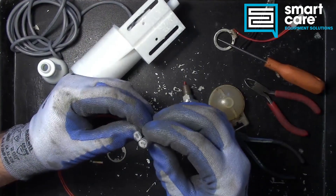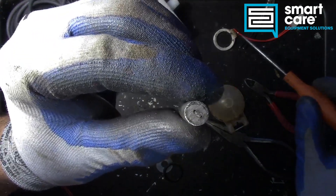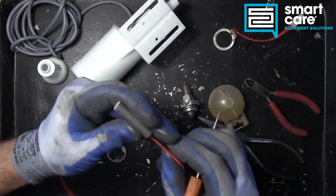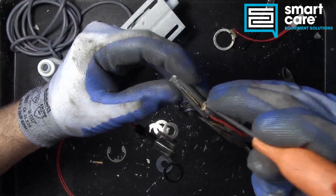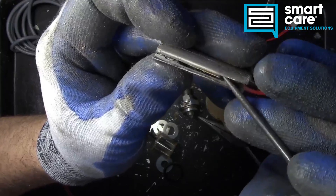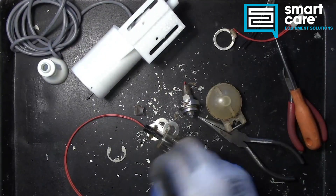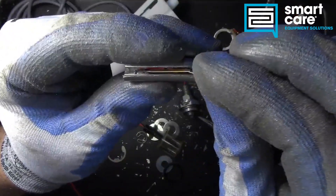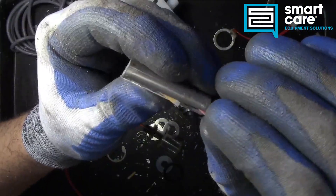I think we'll have to cut it a little more — it may have caused some damage, cut through the tip of it. Looks like I actually cut through just about everything that was in there. I'm hoping we can get these things slid out of the housing. To my total surprise, this thing is full of glass, which means we still have the old style — it's called a reed switch — in here. Here's one of the two reeds, and the other one actually fell out while I was taking it apart. These two reeds just kind of tap together when the magnet comes close enough to influence them. I did not expect this to still have a reed switch inside it — I am genuinely surprised.